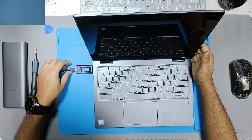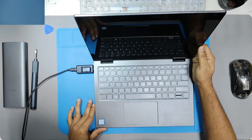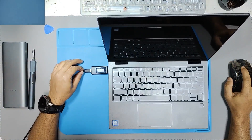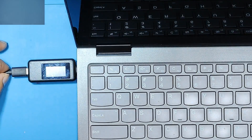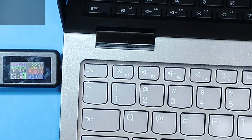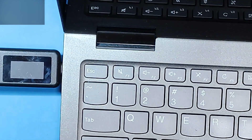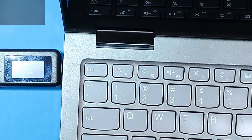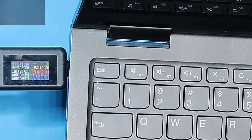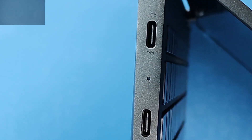Let's see — the adapter is turning on. Let me zoom in for you. Now you can see the adapter. This one takes only five volts. I think the cable got loose — yeah, it takes only five volts, which means it is not communicating properly with the charger. Let me check the port also. The port looks fine, actually — there is no damage.